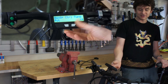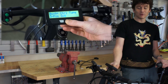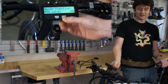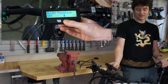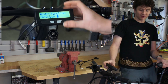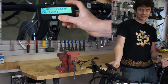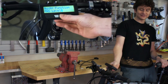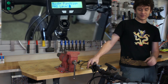The setup and configuration is just like you're used to — now you choose whether you have a potentiometer, a two-position switch, or a three-position switch controlling the analog input. In our case we have a potentiometer, and going to the function it mirrors exactly what we saw for the digital auxiliary input: pedal assist level, amps limit, speed limit, or the new throttle output voltage limit. What you don't see here is power limit, because the digital configuration is already using power limiting, so it doesn't show up in the analog menu. If I changed my digital input to pedal assist level, then I would see power limit in the analog menu, but not pedal assist. Only one control can control any one of those limits at a time.